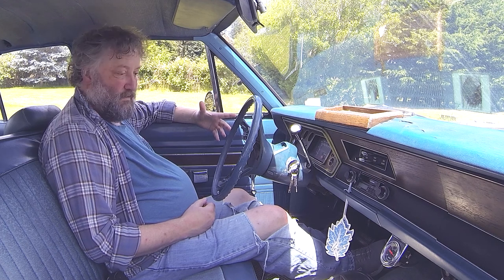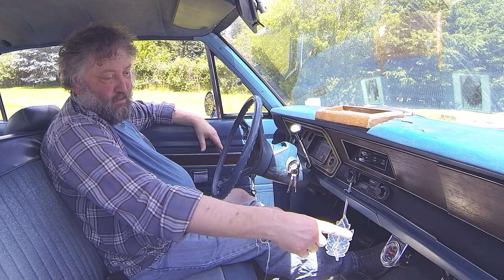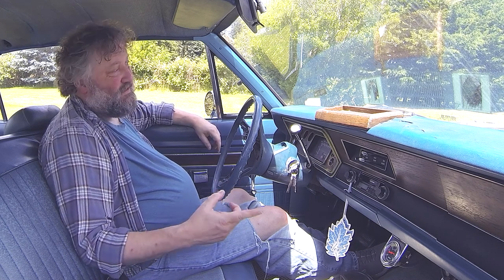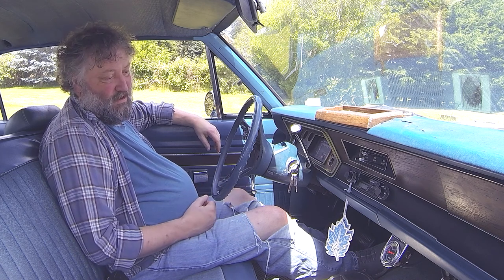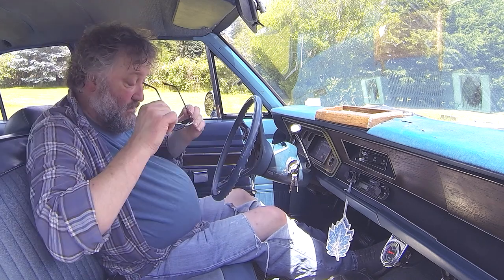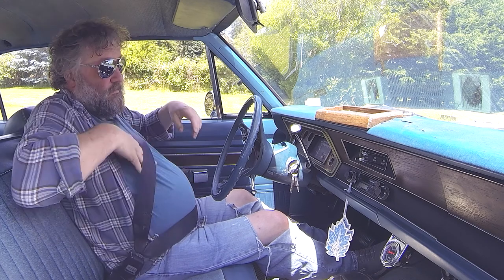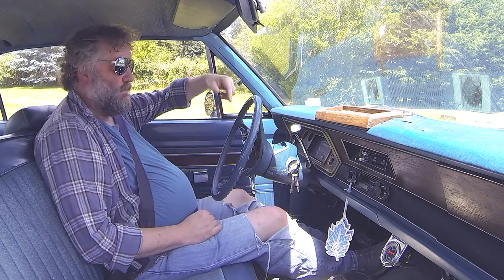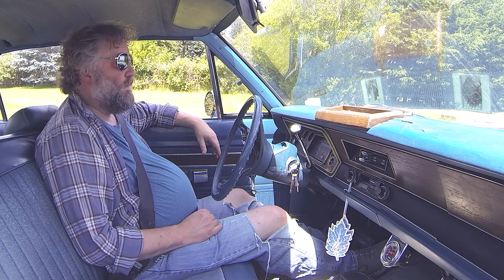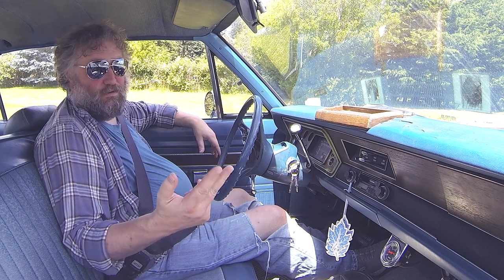Temperature is up good. So it dropped back to about 22 — I'm going to say pretty good. That is in inches of mercury, which is a pretty common standard for vacuum. Now it probably uses some kind of kilopascal thing nowadays, but I also have a portable vacuum gauge that you tee off a vacuum line or you pull a vacuum line off the manifold and hook into it. Vacuum gauges are wonderful — just like a compression tester, a compression tester and a vacuum gauge will tell you almost everything you need to know about the health of an engine.